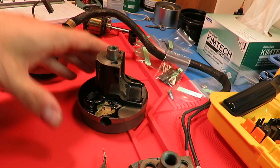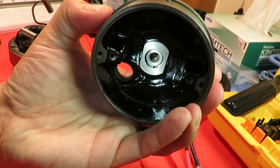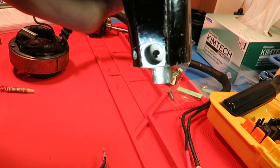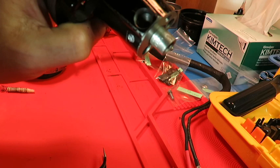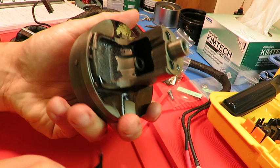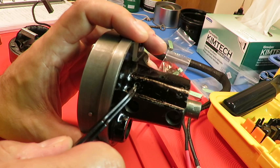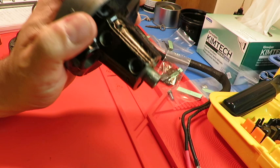The other thing that bothers me a bit is that there's a hole through each bushing, and you can see the hole inside this bushing there, and that hole is contiguous with the hole in the bottom of the motor here. And you can see that in this one, the bushing is a little off. There's a sliver of bushing sticking out there, so the bushing itself is sort of not set exactly right in there. And this is the only thing that I haven't done to these motors to sort of rehab them that I could do, is remove these bushings. The screw for this bushing is right here, and the screw for the inner bushing is here. And you could take these out, use some PB Blaster or whatever, get them loosened up and remove the bushings, and then I could reset that bushing so that the hole was a little more concentric with the outer hole.